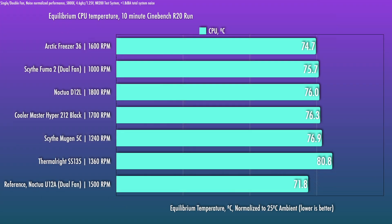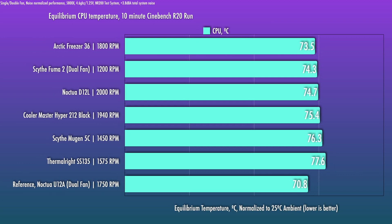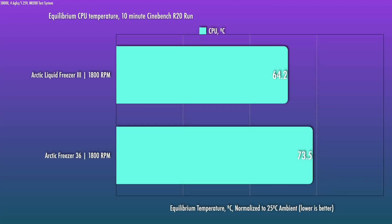Testing with the 5800X, this is really impressive performance from a single tower cooler. The D12L and the Scythe Fuma are dual towers with more heat pipes and are well-regarded, yet they do max out at 1800 RPM — and this is still a top-tier performer at that level. Since the LF3 also uses these two fans, it gives an interesting comparison to see how much more efficient a radiator is. Of course liquid cooling is more efficient at the same RPM — there isn't really a contest there — but it's food for thought.